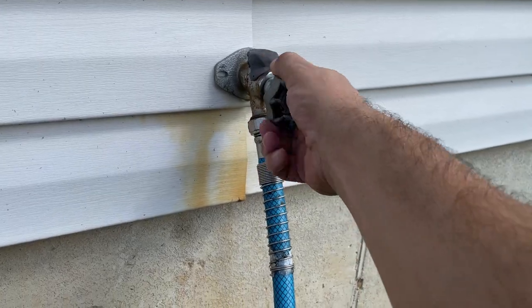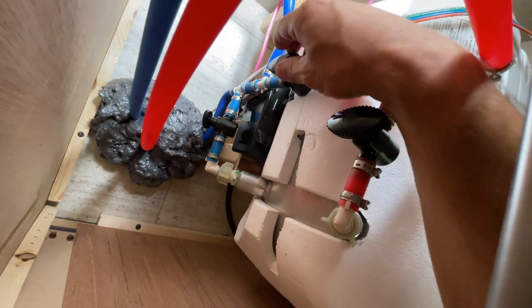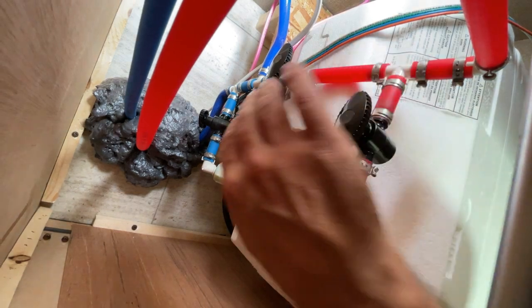Fill your tank up with fresh water and run that water through all the faucets until you no longer smell the bleach solution. You may have to fill your fresh tank a second time and run that fresh water through all your faucets until you get everything flushed out. A good time to sanitize your RV plumbing is when you're de-winterizing, but you can do this process at any point in time. Just remember, once you're done flushing everything out, switch your water heater bypass valves back to normal operating mode: the crossover valve in the middle should be closed — perpendicular to the line — and the cold and hot lines going into and out of your water heater should be open, parallel to the lines. You can now go ahead and reinstall any water filters that you removed or bypassed at the beginning of this process.